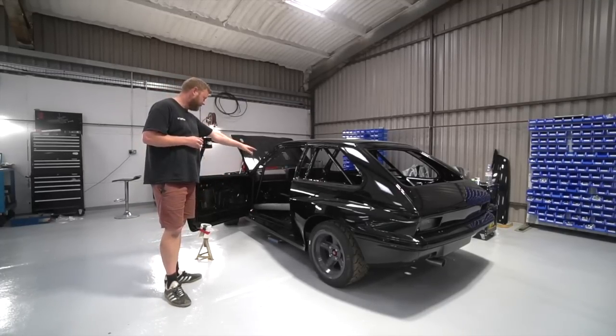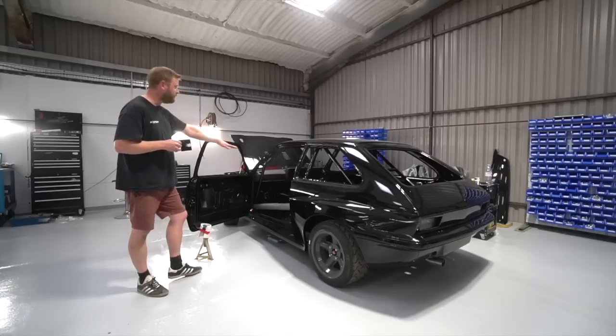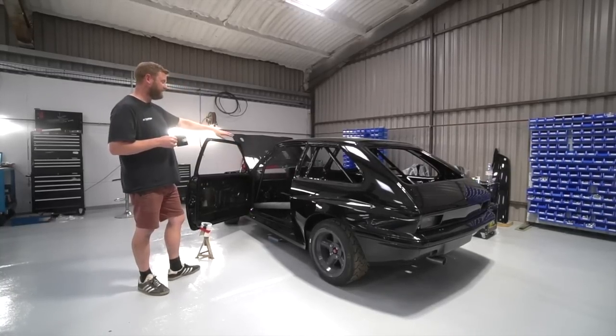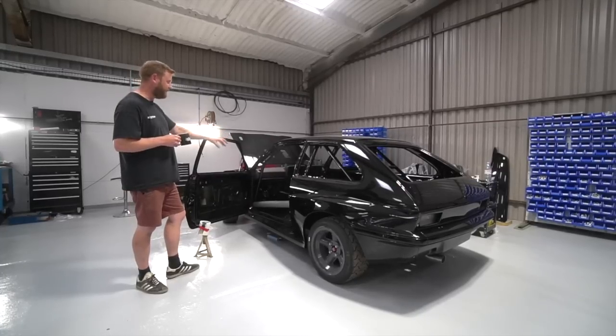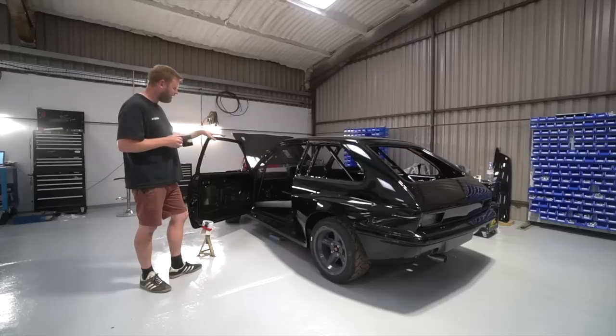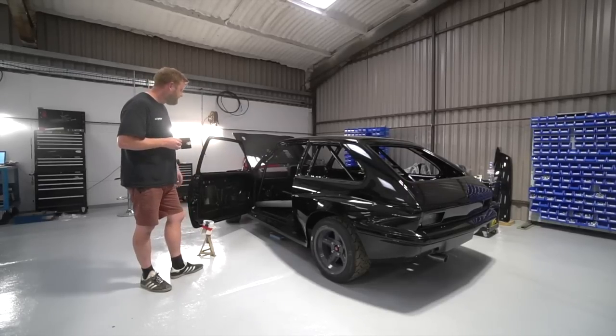The keypad's going to sit on the tunnel more or less where it's lying there at the moment, but on some little billet machine brackets that'll raise it up above the handbrake master cylinder. The idea there is it falls to hand nicely, but it'll also slightly hide the plumbing to the handbrake master cylinder, which will make that whole installation look a little neater.